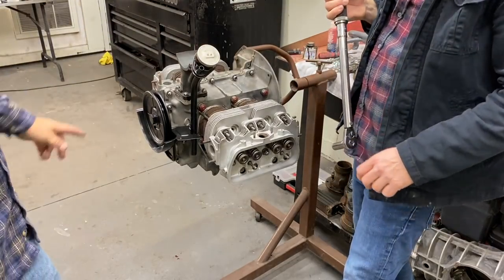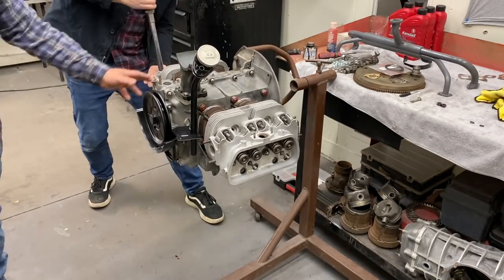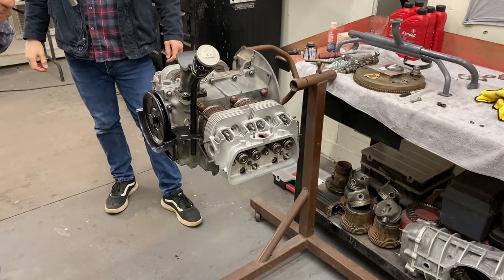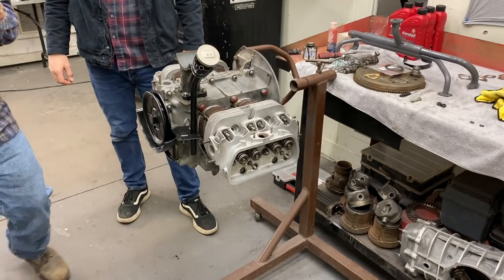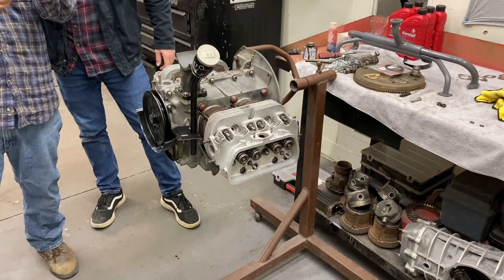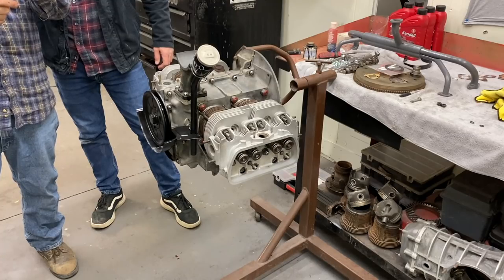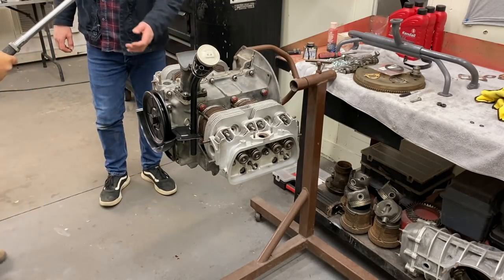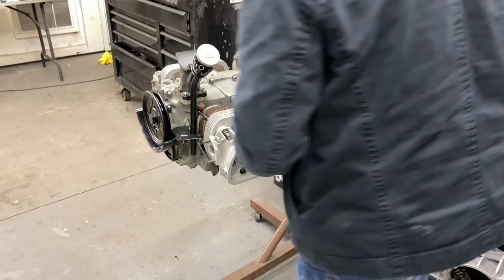All right, now we're going to go to this side. We're going to bump it up a couple pounds here. So that was at 25? 25, now we're going to go to 27. See, it's on the line down there. So that's 25, 1.5, two. That's 27. Gotcha. All right, go back to the other side over there and start in the center and do your crisscross pattern.